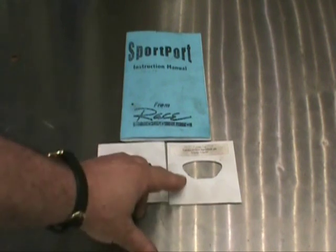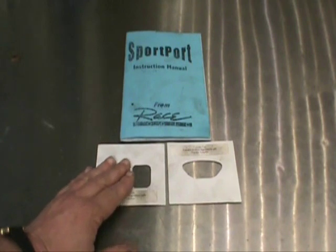We're going to do some additional things besides use the templates, but the reason I think we need to use these templates on this job — I can't explain these angles to you without sending you a template, which is plagiarizing his product. I'm not going to do that. You're just going to buy this product from John. This costs $59, about $70 shipped. Very durable. They hold up good and they're easy to work with, but I can't explain all these radiuses to you. These were all calculated by John to promote ring life and increase longevity of the piston rings. You're not going to get into trouble with these. So that's the first purchase — racelogic.com.